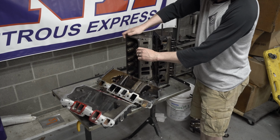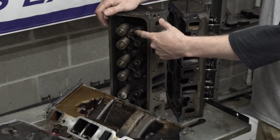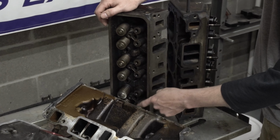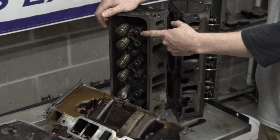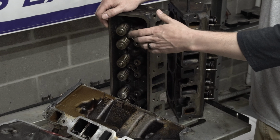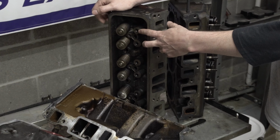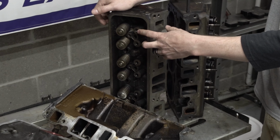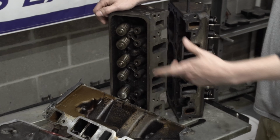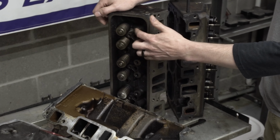The other side of it is, with the 113s, they use a screw type rocker arm with a brace that runs across for all 6 of them. But because of this, you can convert this over to a stud rocker arm. Comp Cams and a lot of different places make them. And so what we'll end up doing, this is an M8 1.25. Some guys drill it out to an M10 1.50. We're not going to be doing anything aggressive on the cam, so we're going to stick with the M8 1.25 to a standard poly lock size poly nut.